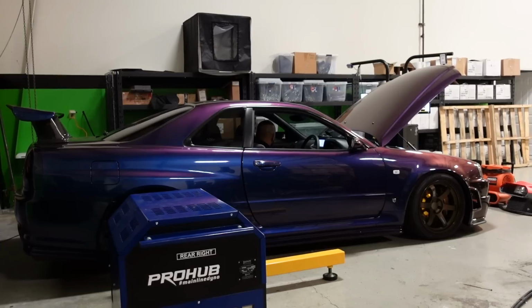We've been chasing our tails all day with this R34. Thought we had a fueling issue, so we were messing with the fuel pumps and cleaned the injectors, and it turned out this whole time we were fighting a bad O2 sensor. What's funny is that because of that, the car in closed loop thought it was lean, so it was dumping a bunch of fuel. Once we put in the wideband from the dyno, we saw it was actually running like 9s AFR, which means I'm losing a ton of power. Fixed it, now it's making good power again. Now Jamie can do his thing, but unfortunately we only have like a half hour before I bring him to the airport, so we're running out of time.